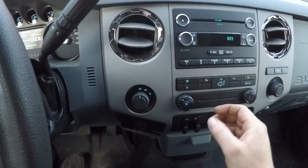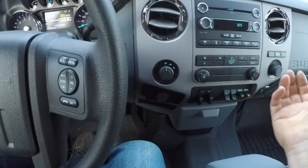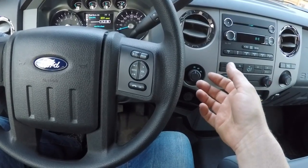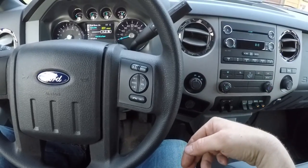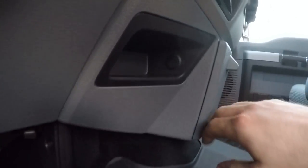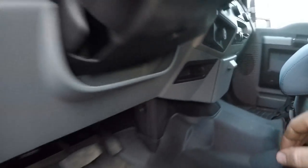To enable those red LEDs on the back rack to serve as brake lights and signal lights, I'll explain how I had to do it. I couldn't use the upfitter switches for that because those switches only switch power, and the brake and signal LEDs needed switching on the ground side of the circuit. To get power for a good brake signal, left turn, or right turn, the easiest way was to tap off the circuits going back to my seven and four-pin connectors at the back of the truck that run trailer lights. I ran that power up through the LEDs on the back rack and brought a wire back behind the dash. I hid a small round rocker switch down in a cubby hole right there, and that switches the ground side of those circuits, completing the path and enabling those lights. Whenever I want brake and signal lights in operation, I just pop that little rocker switch up.